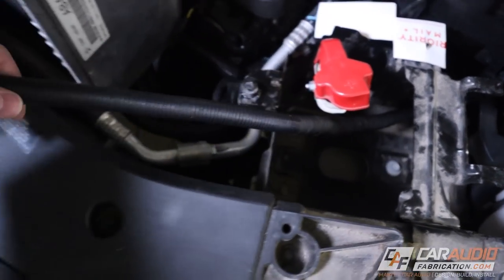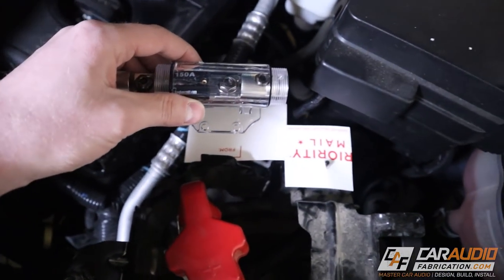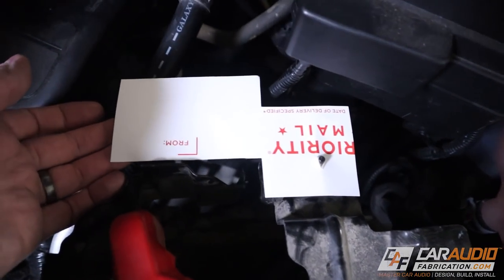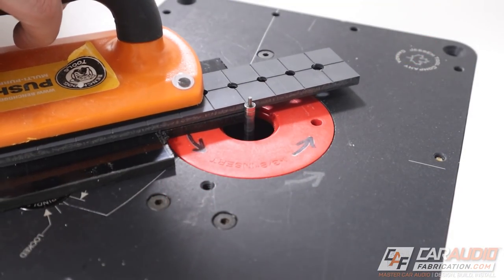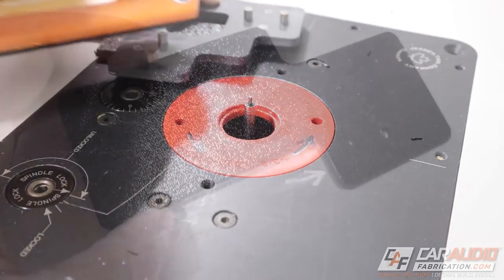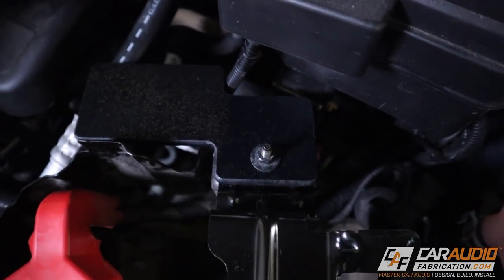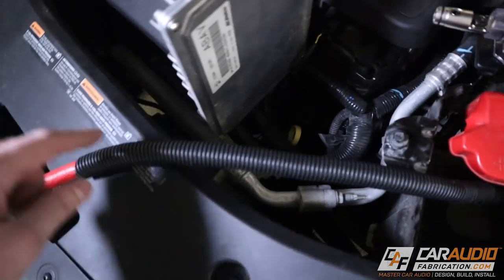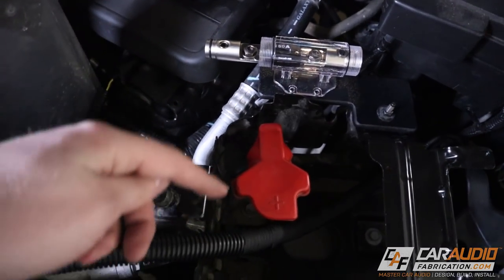I've got this all wrapped up with tape and I've left myself plenty of extra wire because now I need to figure out where the fuse block is actually going to be mounted. I've taken a scrap piece of cardboard and cut out a rough shape, and now I can transfer this to a piece of plastic. Now you could just use a jigsaw, but I'm a bit of a perfectionist, so I'm going to be using the router to make these cuts nice and clean. Now that I have that plate made — and you can see that it bolts up using a factory bolt location — I can determine exactly where I want this, get this mounted, connect this wire to this side, and then make a new wire that's going to connect to the battery.